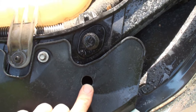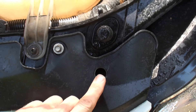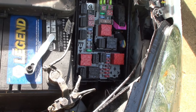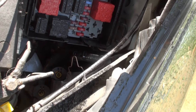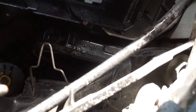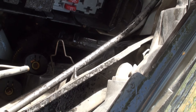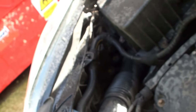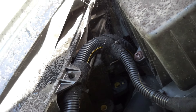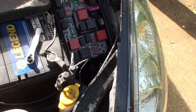Be careful you don't drop the bolts. You can see the fuse box there - I've taken the lid off. It says in the manual to undo the clip and push the cover back, but you just can't get in there. You're going to have to take the headlamp out just to change the bulb. The manual is wrong - presumably the fuse box has been relocated at some point and blocks it off. You may have more joy on the driver's side as there's more room.